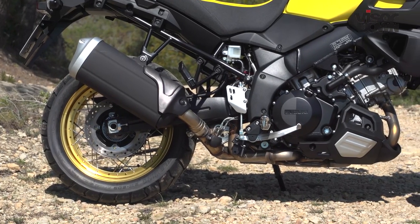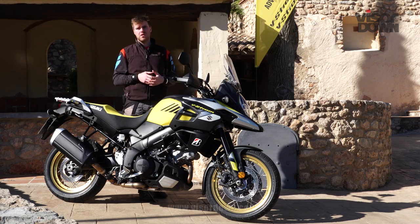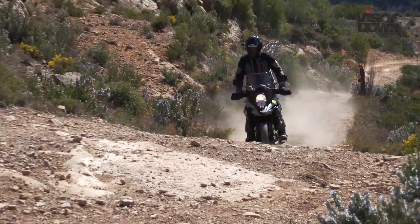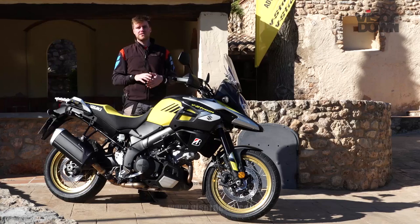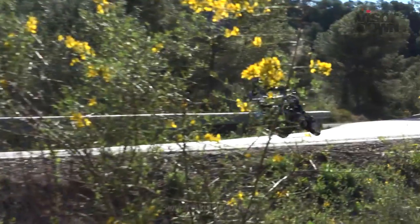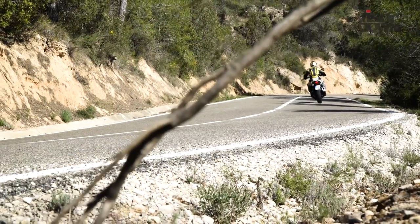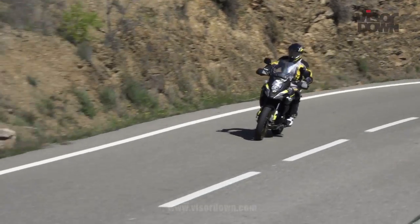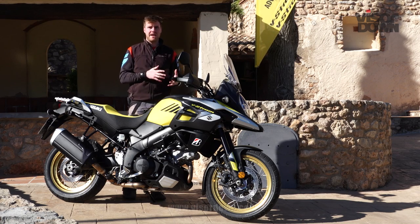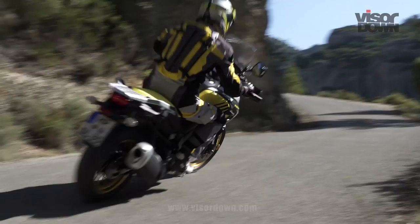The engine's a little bit of a strange beast. A lot of engines in the adventure bike category have a lot of character — they either have a big punchy torquey motor or they make crazy power at the top end. The V-Strom is the other way: it's super linear power all the way through, with a lot of torque hit near the bottom, around 4,000 to 5,000 RPM. When you rev it and keep the revs high and the gear low on twisty roads, I'm not really a fan — it's kind of linear and a little bit boring. But when you run a gear high everywhere and let the bike roll, then use that V-twin torque to pull out of a corner, it's really a lot more fun to ride. It changes the character of the bike from being a bit bland to a little bit more exciting — still not exciting, but it's the most fun way to ride the bike.